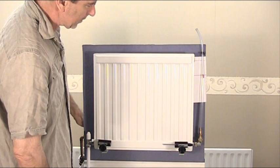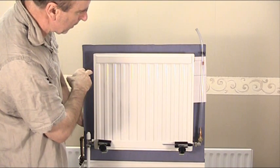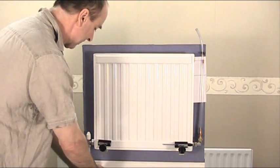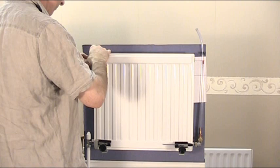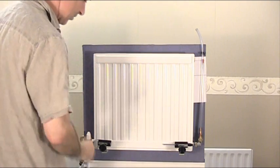So you can see it come up to the top and you'll see water coming out here any second - watch. There you go. So we'll put the bleed nipple back now to seal it off, and we know now the radiator is actually full. Full of water.